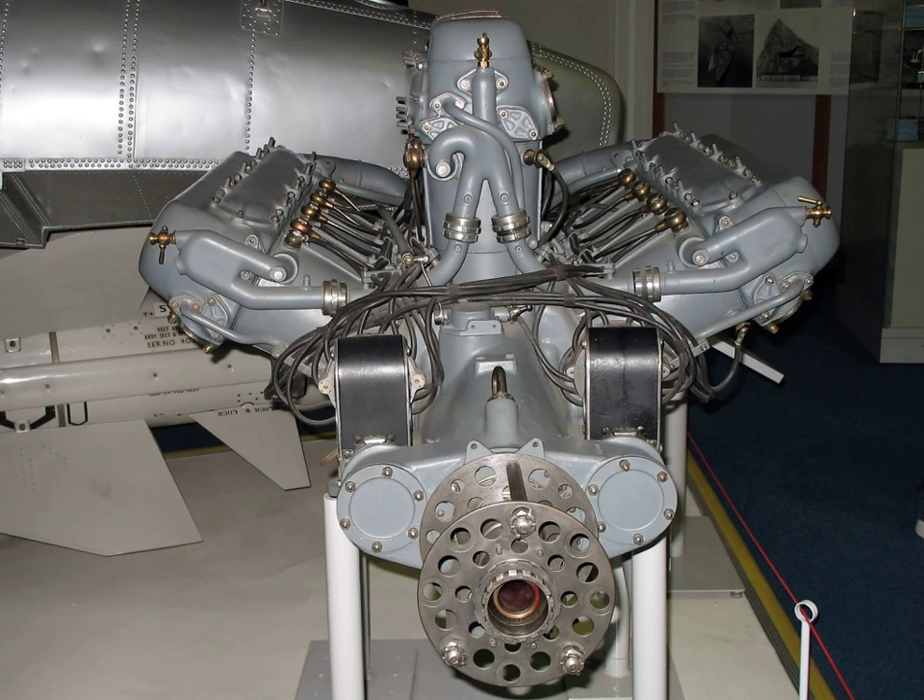The narrow 15-degree angle between bank pairs makes this resemble a V-12 engine, in that it has just two cylinder heads and two sets of camshafts. The W-12 engine has a bore and stroke of 84.0 mm (3.31 in) and 90.2 mm (3.55 in). Volkswagen Group went on to produce a W-16 engine prototype which produced 465 kW (632 PS, 624 BHP) for the Bentley Hunaudières concept car. A quad-turbocharged version of this engine went into production in 2005, powering the 736 kW (1001 PS, 987 BHP) Bugatti Veyron EB-16.4. The major advantage of these engines is packaging — they contain high numbers of cylinders but are relatively compact in their external dimensions.